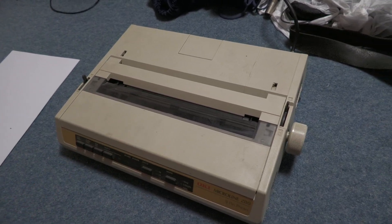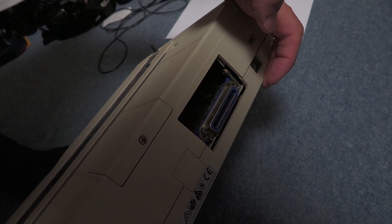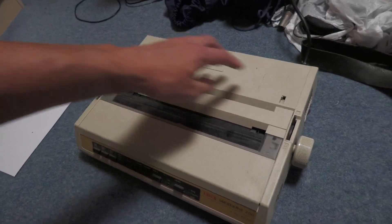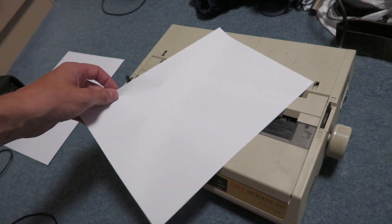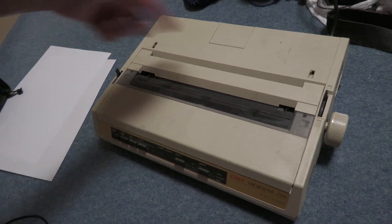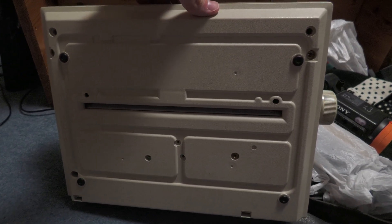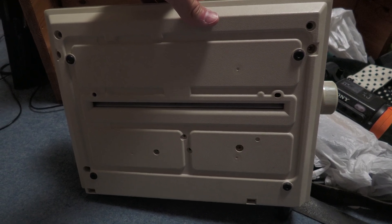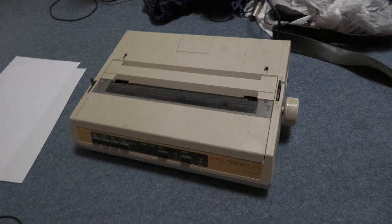It's a 9-pin impact printer. Around the back you can see it's got a parallel port; the newer ones have USB ports. There's a gap where you can put a serial port in — I did have the card but unfortunately it got thrown out. That connector is for a stand, because you can put multiple different things on here: a cut sheet feeder which will automatically load individual sheets, a roll of paper — I do have some rolls but don't have the stand anymore — and there's another tray for loading individual sheets. Interestingly, if you turn it upside down, there's a big slot in the bottom so you can feed tractor paper in through the bottom and out the top, or put paper behind and have it come in and back out.